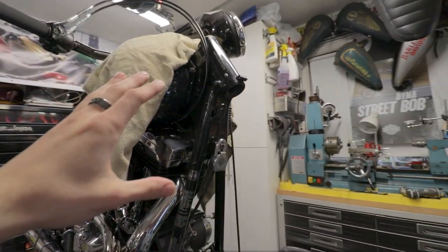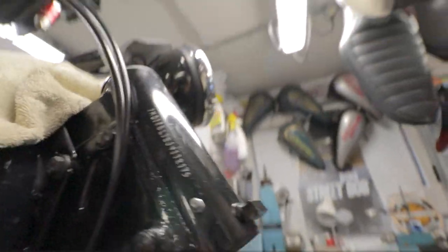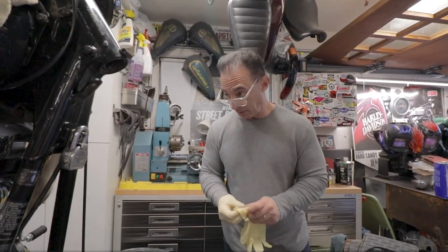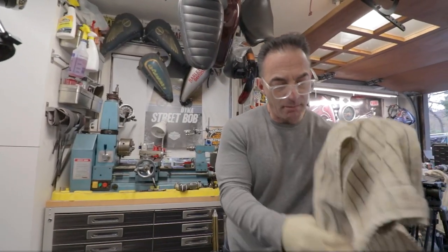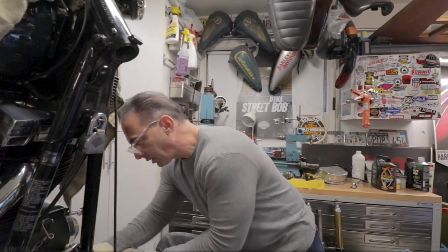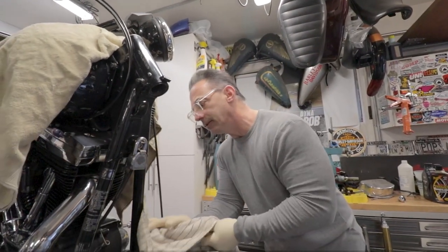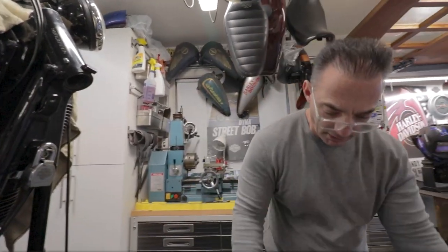The original front end is taken off and the triple tree is out. I greased the bearing, put the cap back on, and put some new grease in there. Now we're ready to slide it in. We're going to lift the front of the frame as high as we can because we already put the bottom tree on, so we'll dream-weaver it in there and not scratch anything — in theory, it'll go super easy.